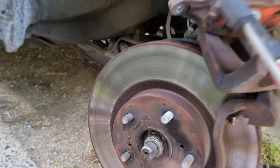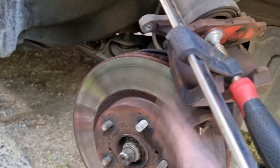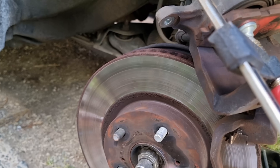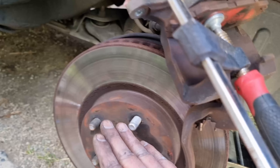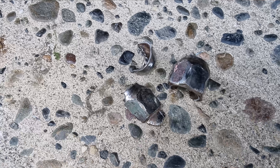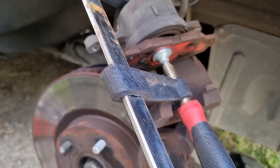Had to change the lug nut as well — the old one was threaded on. I'm trying to make this job as quick as possible, so what I did was just get the grinder. Because of the rim that's on there, it allowed me the space I needed — just the cutting disc on the grinder — and then I could hit it a few times with a hammer, get the lug nut off, take the little stud out, and change that while I'm in there. Luckily I'm doing the brakes, so I can take the wheel off easy.